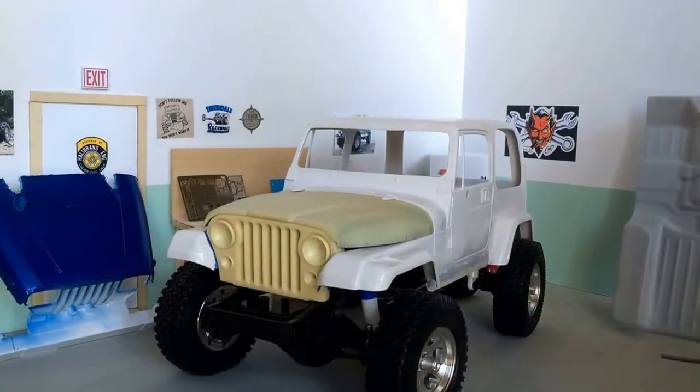So I'm probably either going to need to go back and order a shorter spring, either the 80mm or maybe even a shorter shock setup. Or what I'll do is end up cutting down the coils inside and putting them back into these springs just to give it enough so that it has a little bit of a ride, but it's not going to get very much suspension at all. But I'm trying to go for a more scale appearance than a more off-road, more aggressive appearance. So it really doesn't matter to me how much spring is in the shock, as long as it'll allow for the little bit of travel that I need to make it look realistic. So I won't know that until I get all the stuff put in here and get it up to its final weight and take it out and test it a little bit.